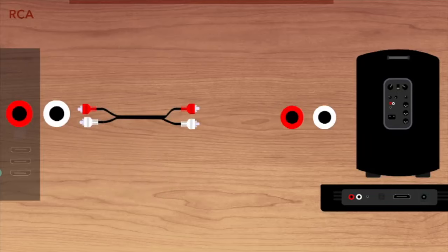If you have speakers without these inputs, they're likely passive speakers which need to connect to an amplifier for power. The amplifier should have RCA inputs labeled audio or line in. Just make sure to change your stereo to the channel that you connected your RCA cables into, and go to your TV's audio menus to select external speakers for your sound — that is, if you don't hear anything right away.